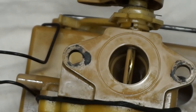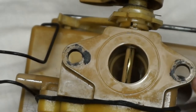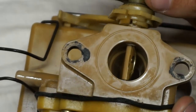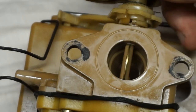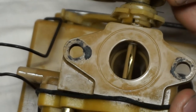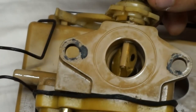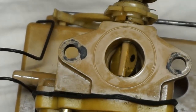From looking at my spare carburetor, I've determined that my shaft — the little plate that slides through — the bottom's broken. I can see how I can slide that up and down, which means the bottom is actually missing a little piece of plastic. So now I have to disassemble this whole thing and swap some parts from my spare carburetor. That's additionally why it was always so loose — there's a little dimple on the bottom of this shaft that should be longer, and apparently it's broken off. So I'm going to film this whole process and we'll see how it goes.